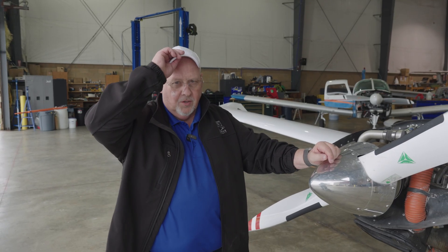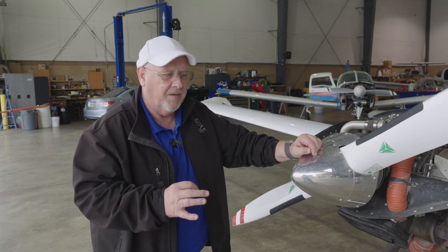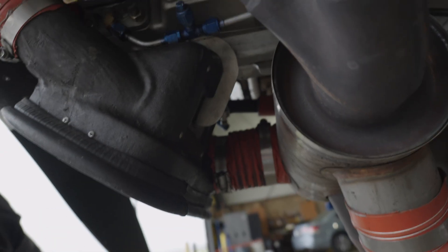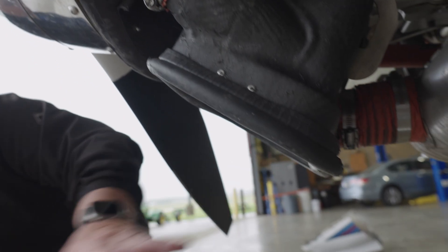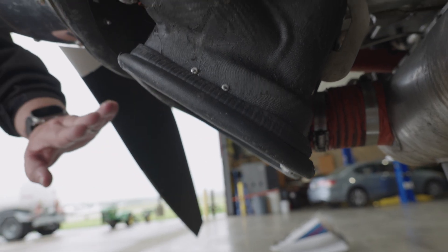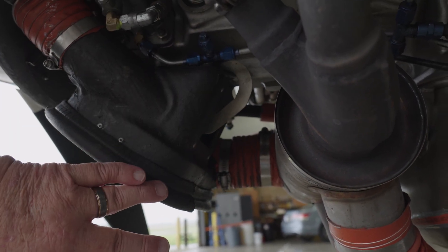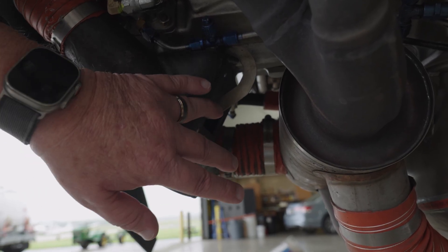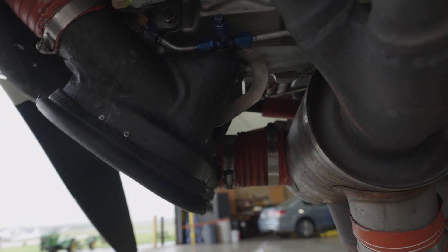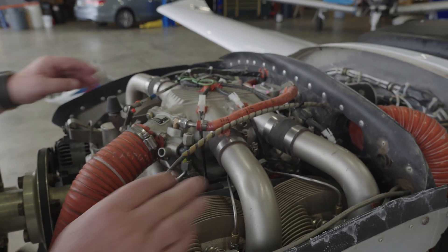What we're going to do now is take a look at a Diamond DA20C1. The purpose of this video is to show you guys all the different alternate air systems that we have on these various aircraft. The normal induction air goes right into the front, right through the air filter. If that filter starts to block off at all, we have to make another path for it. That other path is the backside of this filter has a door. We'll go ahead and open that alternate air door up, and as we open that up, that creates an opening that allows air inside the cowling to run around that and get pulled in.